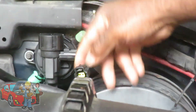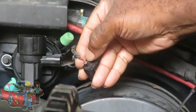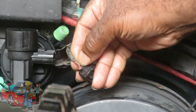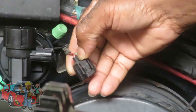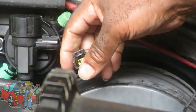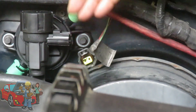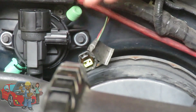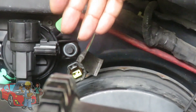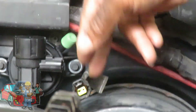The next thing we're going to do — we've got to check voltage at the red wire with a yellow tracer. We're going to get our power probe. Now, you can use a power probe or a test light, but I'd rather you not do that because I need you to check voltage — use a multimeter or something. I need you to read the voltage. The power probe 3 is going to have a voltage reading on it. Alright, we'll be right back.